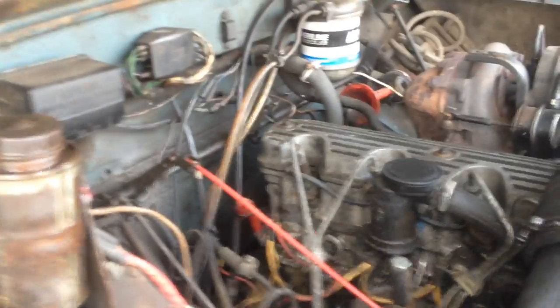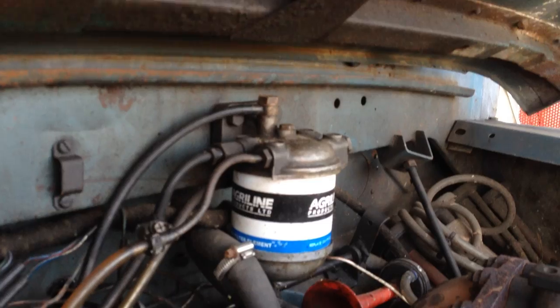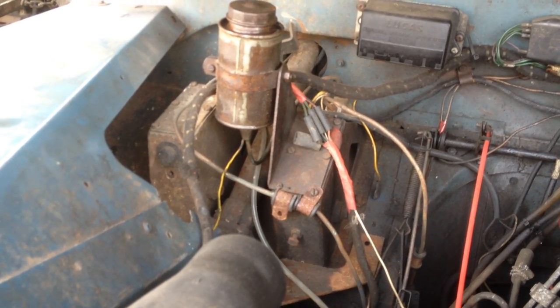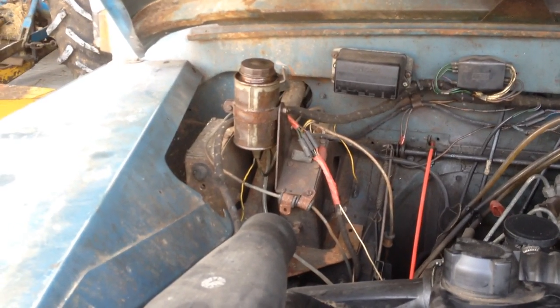The throttle linkage is solid so you do get a bit of kangaroo going on, but it doesn't really matter to me too much. The fuel lines - you can see a clear line so I can see if there's air in the system or if there's any bleeding to be done. When I'm bleeding it you can see if you've finished bleeding the filter. The filter is Lucas CAV, because instead of doing the Discovery filter - you can get those nice and cheap - these Lucas ones were used when I ran veg oil, so I was going through filters routinely. There's no brake servo even though it's on disc brakes - that's to be addressed at some point. It's a long wheelbase master cylinder which seems to have made the pedal even firmer. It's had a long wheelbase master in it for four or five years now, and only Discovery axles for a few months.